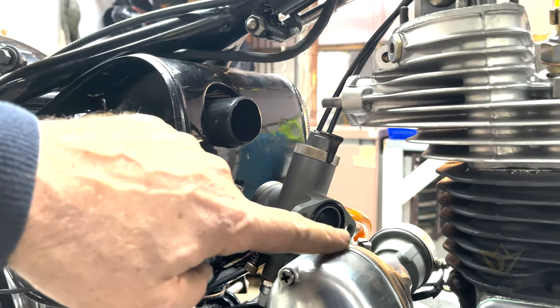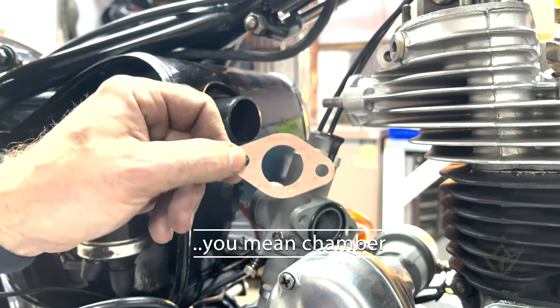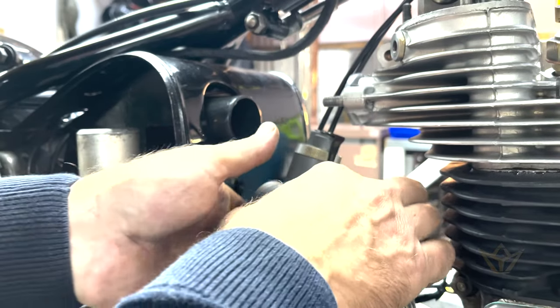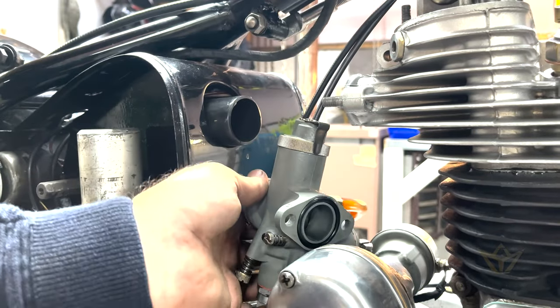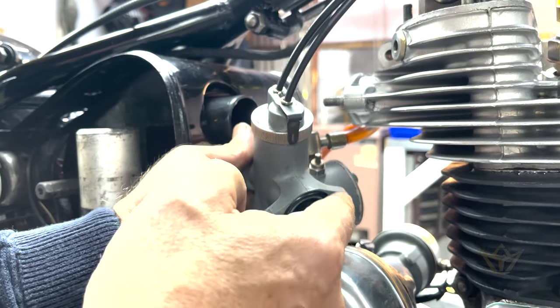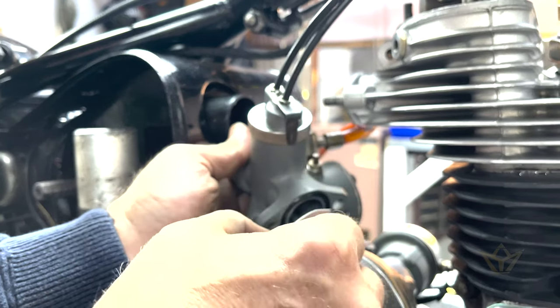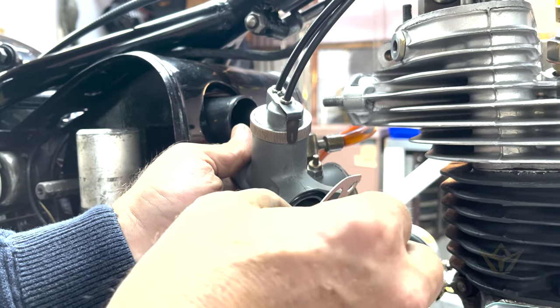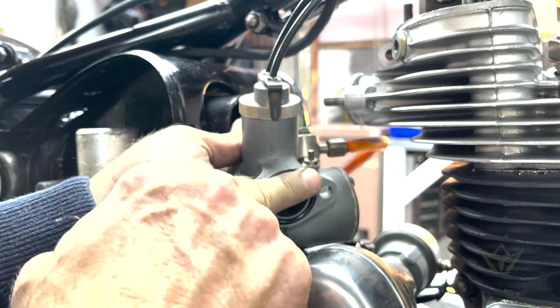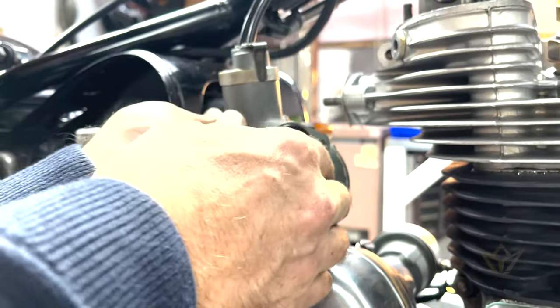You don't put weld seal on there. You don't want to get anything in between the pure fuel going into the carburetor and also the gasket. Now, that's a very important key point, and this is why you saw in previous videos, you would have seen me having to flatten off this face because these two ears have been bent in. So when it bends in, then air gets in and it becomes inefficient. We need to put the rubber seal in, and then you need to put this flat gasket on. And this flat gasket really is there to stop you from over tightening this carburetor.